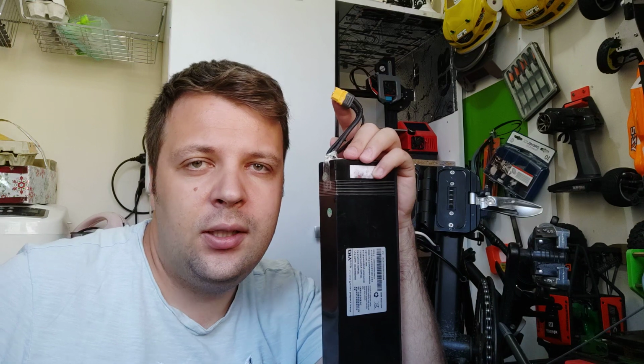In the adapter for the old D4S for the 340 millimeters battery, you can use the stock connectors. I mean, you don't have to do anything because there is enough space. I mean, not enough. You have to struggle a little bit to put all the wires inside the adapter. D2S is the same. The only issue is with the D4S new battery with 350 or more. You cannot put everything inside, so you have to make the wires shorter. If you do this, I would recommend to change the connectors. In any case, I would recommend to change the connectors.